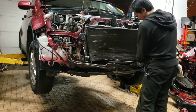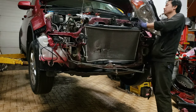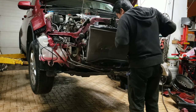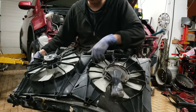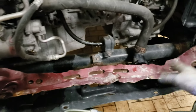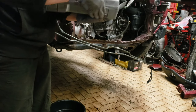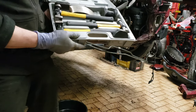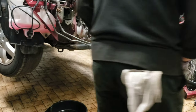It's not too bad — it kind of fits. There's our rad; the band's all broken and this side's broken too. Our lower rad support here is obviously a little mangled. What we're going to try to do is hammer and pull and try to get this all straightened out. We got our hammer and dolly set here with an assortment of body hammers and dollies to help with this straightening process.